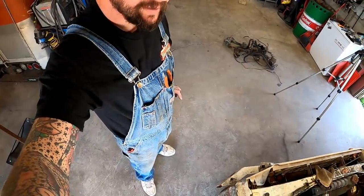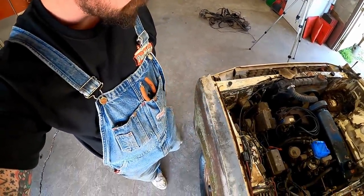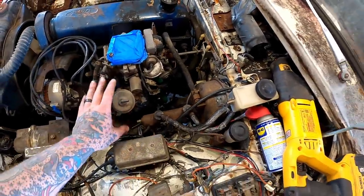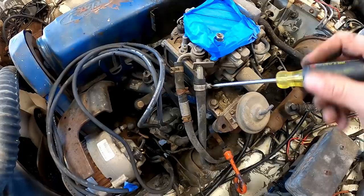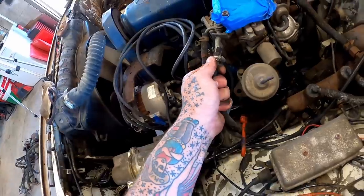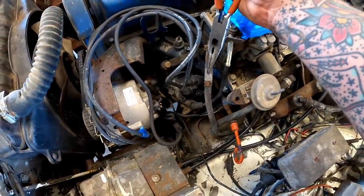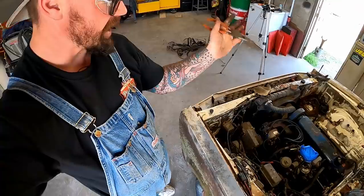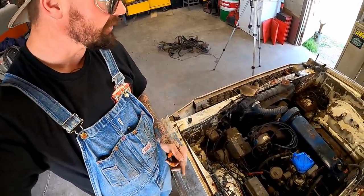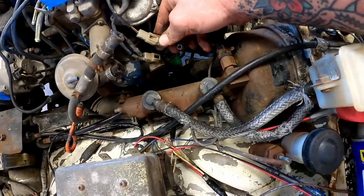Now, instead of standing around doing nothing, why don't we just pull off this carburetor? Even if we keep the factory carburetor, I still want to get rid of this bull crap. So this here's gonna be our supply. She's slightly brittle. This one here is gonna be our return. We know that because that little diaphragm right there restricts the fuel return, actually. Oh, that baby's pretty underneath there.